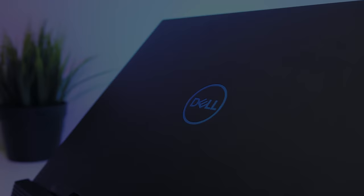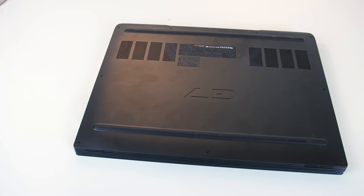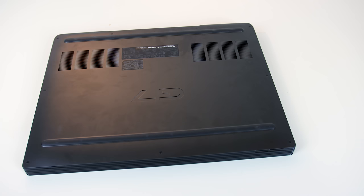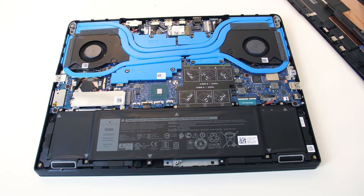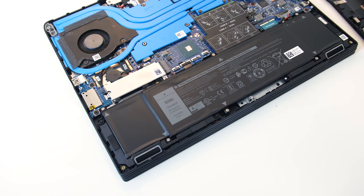On the black metal lid there's the Dell logo in the center with a blue shiny finish, which can also look a little green depending on the angle. Underneath there are only small vents for airflow directly above the fans. The bottom panel can be removed easily by taking out 9 Phillips head screws, and the two at the back towards the center don't come out of the panel. Once inside, from left to right, we've got the single M.2 slot, two memory slots, WiFi card up the top in the middle, and large 90Wh battery down the bottom. You've got the option of getting a smaller 60Wh battery instead that also gets you a 2.5 inch drive bay, and I really like that Dell are giving you that option.